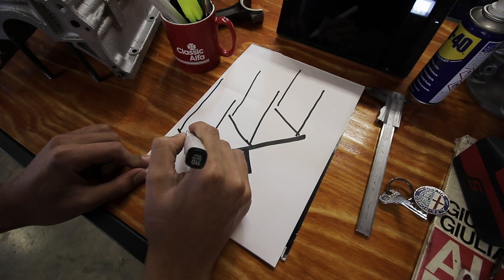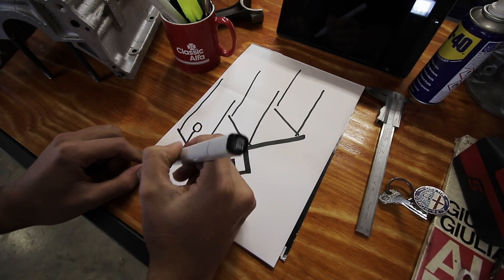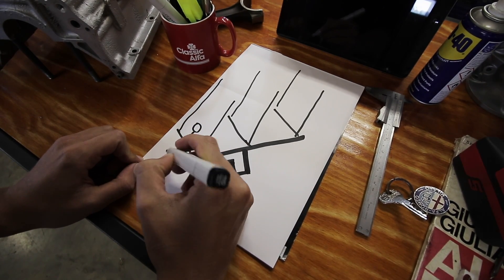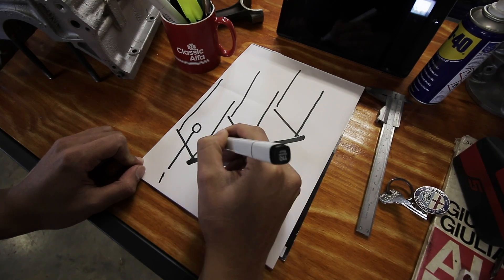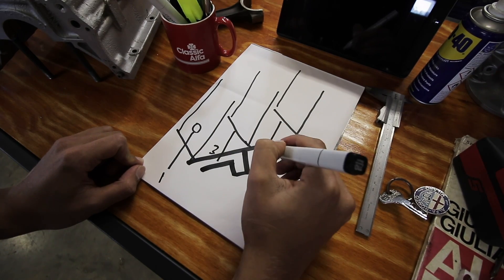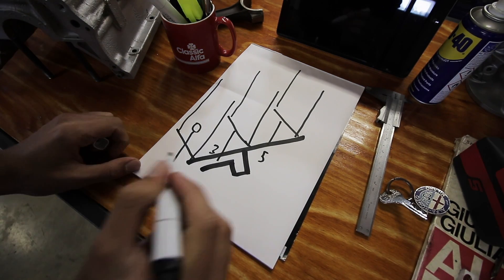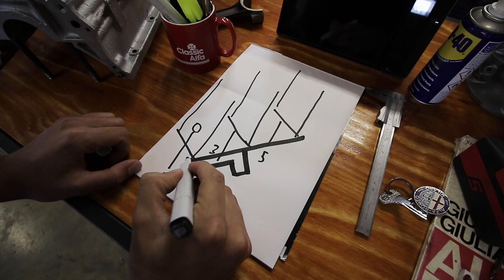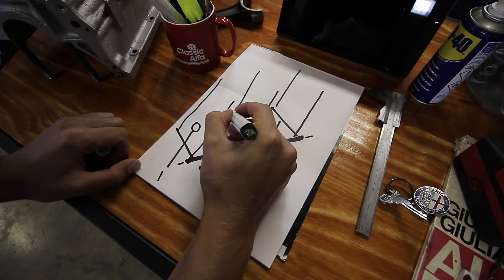Here it's drilled from the timing chain gear down to crankshaft main bearing number one, and here it goes down to main bearing number three, and this goes down to main bearing number five. That's essentially the pattern of the oilways. There's no real hiding spots. All we have to do is open up the channels here, here, and along these points.